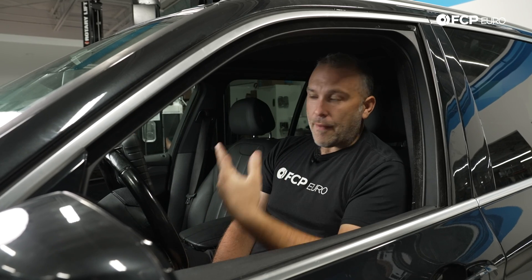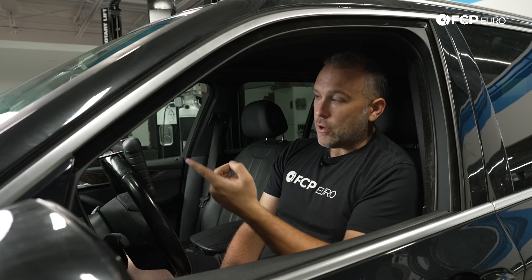We've done this the electronic way — that is the easiest way. After you install injectors, you're going to need to enter the calibration numbers anyway, so you'll need the scan tool regardless. But we're going to show you how to manually identify the injectors too, which isn't bad just to double-check and make sure the information you're being told is in fact correct.